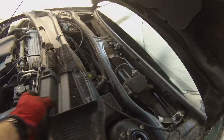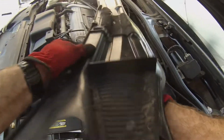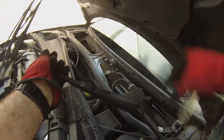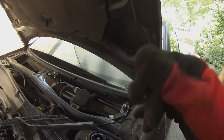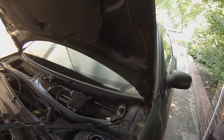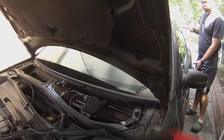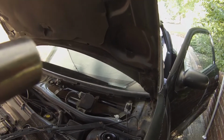Should we at least test the mechanism before, like, I could turn it on and see how it starts. Yeah, you could. I was going to put the wipers on there to see, but well, you know what? I'm just wondering. It comes to rest, you know, when you start it up and it comes to rest to stop. That's the part that we need to figure out, because you don't want the wipers to stop up on the windshield. So if you start it, we could test it and then shut it off, and it should come at rest by itself. Yeah, just tell me when. Well, just turn it off at any point.